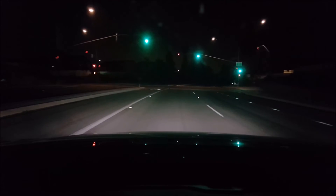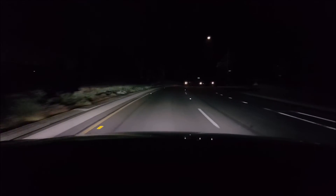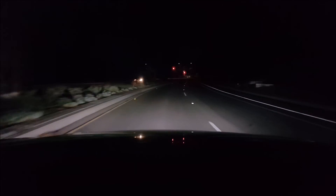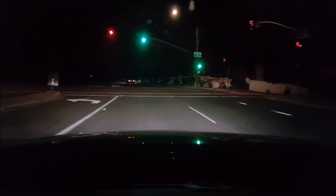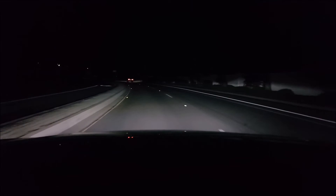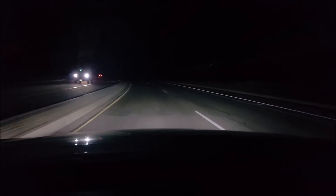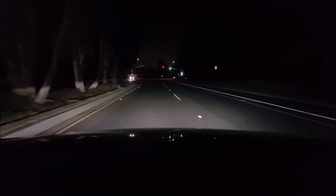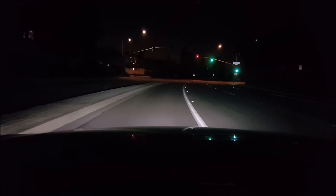Here is a nighttime driving demo with the new SL1 LED headlight bulbs from Diode Dynamics. I'm driving on a back road that doesn't have a lot of street lights. As you can see, the color output is white — not the off-white of the stock halogen bulbs. It does a decent job of projecting light out onto the road and is an improvement over stock. However, if you want the best light output possible, I would suggest doing a retrofit project where you open up the headlights and install HID projectors.